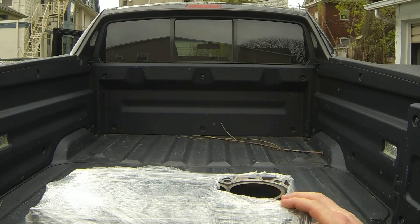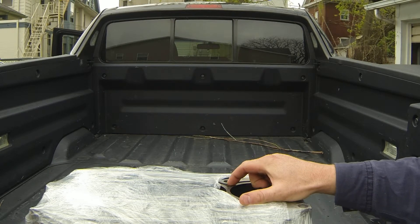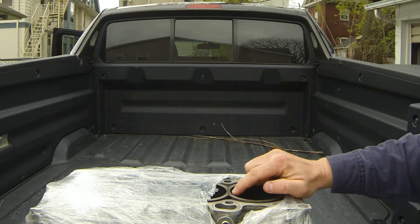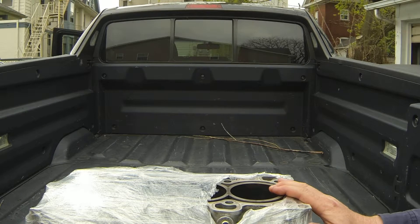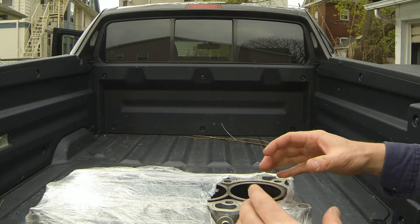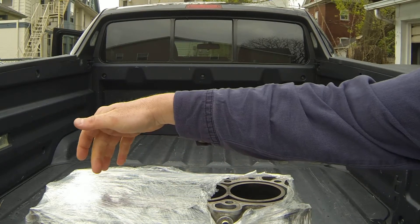These sleeves were installed probably almost twelve years ago. Generally on aftermarket sleeves there's approximately a thousandth gap between them. There's normally a thousandth or so, if not a little more, gap between the sleeves. What that does is it allows the sleeves to float a little bit. These are dry sleeves — they're epoxied in and they really don't move. But anytime you heat up metal it expands out and grows. So if there's not a little bit of gap between all of your sleeves, when this one expands it's going to side load the next one, and it's just going to go right down the line.